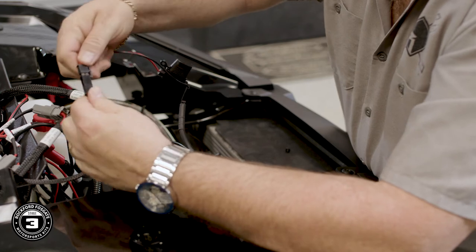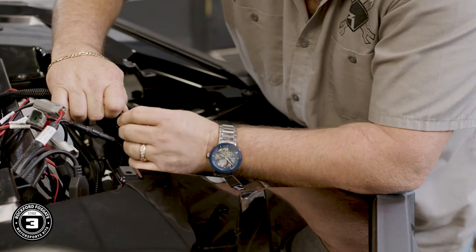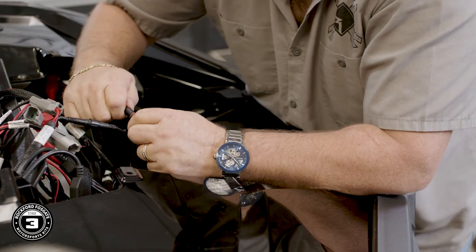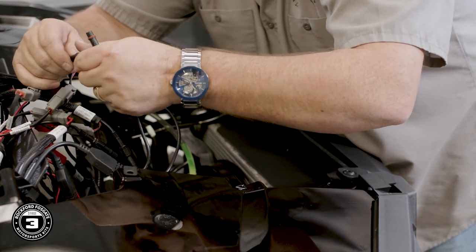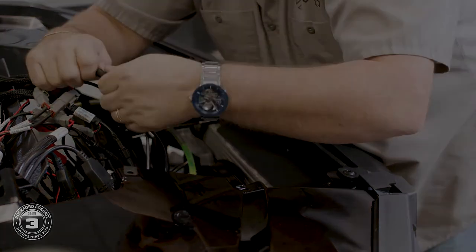You're ready to install your new Color Optics controller. This is a Bluetooth device that will allow you to remotely access the lighting features through the RF Connect app. Start by connecting the power cable to the PMX harness and then attach your waterproof connectors to the speaker cables. Now is a great time to go through and secure your wiring runs — be sure you have proper clearances where needed and all loose slack is tied up.